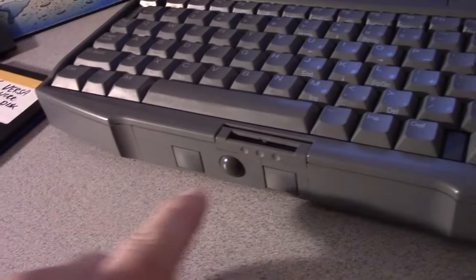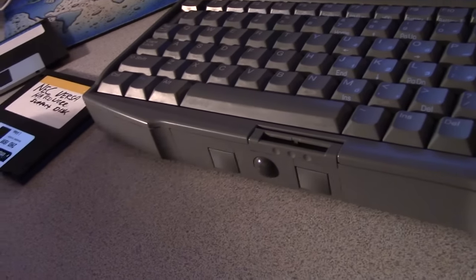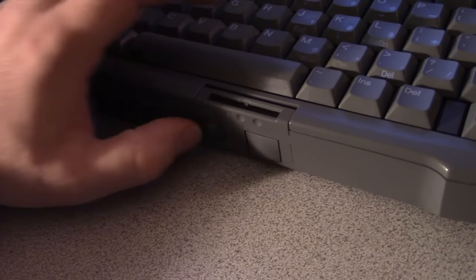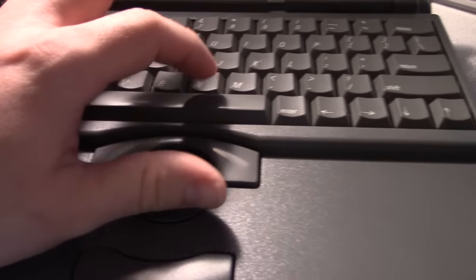Very smooth, very effective. This machine has a trackball that's mounted so the weight is not quite on those bearings, but the bearings are made out of steel, possibly stainless steel. Once the stainless steel, which is coated with, I believe, a chromium type substance, wears away, it doesn't really roll that nicely. This one doesn't seem to have that problem, but it's certainly not as smooth. Now, the other downfall to this trackball is its size. It's a very small trackball, so it's jumpy. Doesn't move very smoothly. This trackball is much larger, so it's a little more precise.